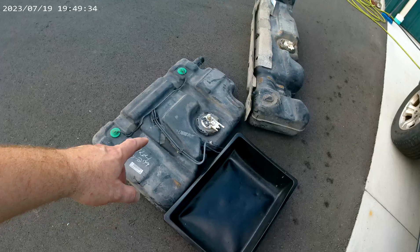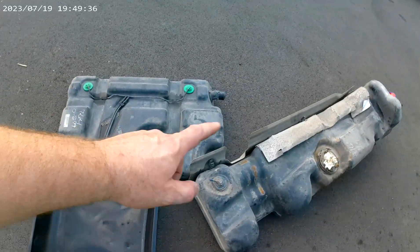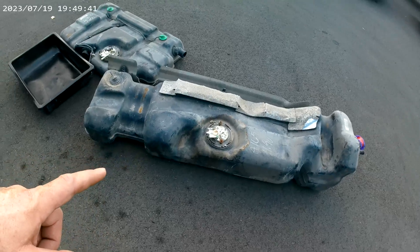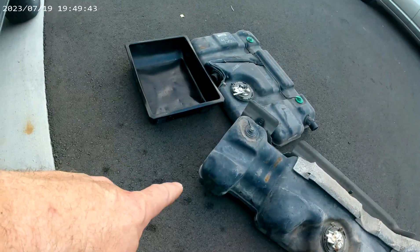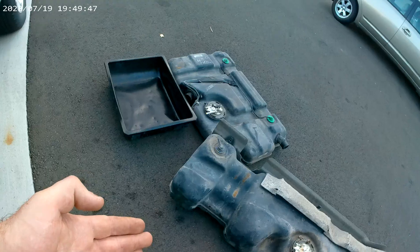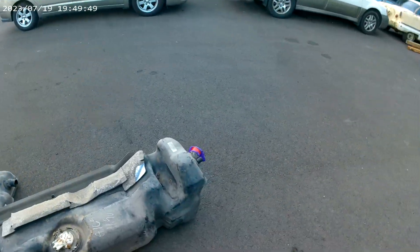On the gas tanks — from the 2500 rear tank and front tank — the front tanks are pretty similar to the 1500. The only real difference is the front of the 1500 tank has a slant cut to clear one of the crossmembers. We'll show you that when we get over to the other chassis next to the building.